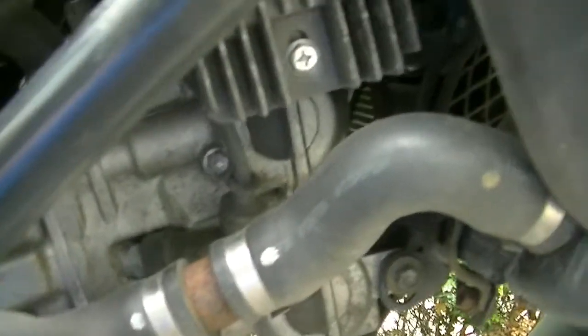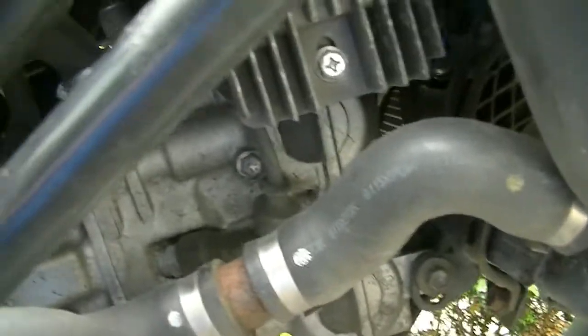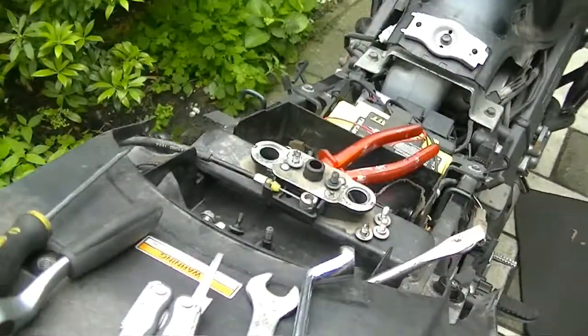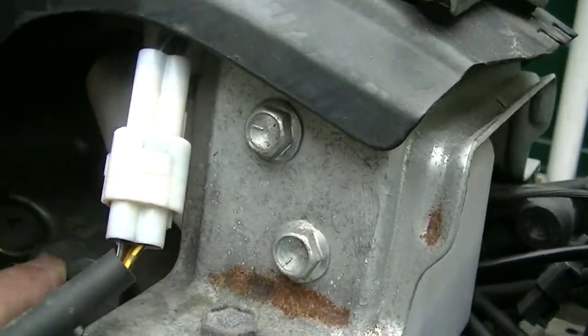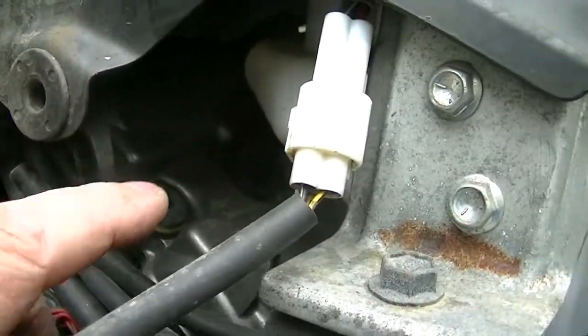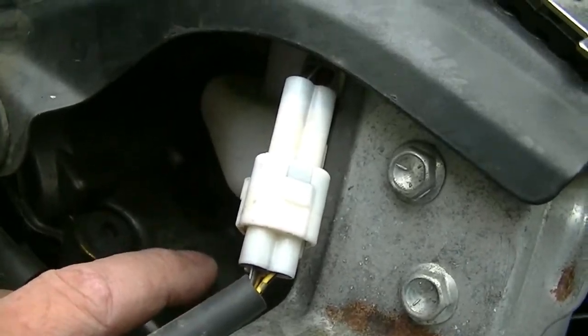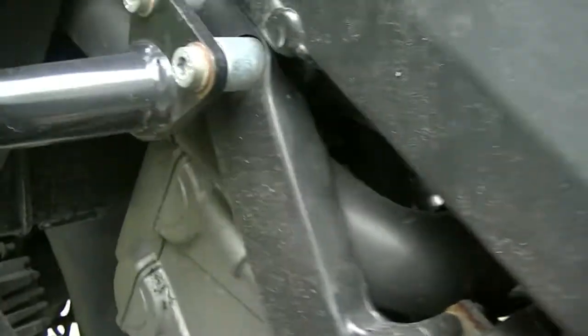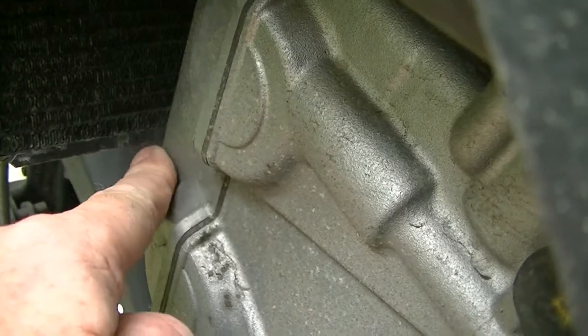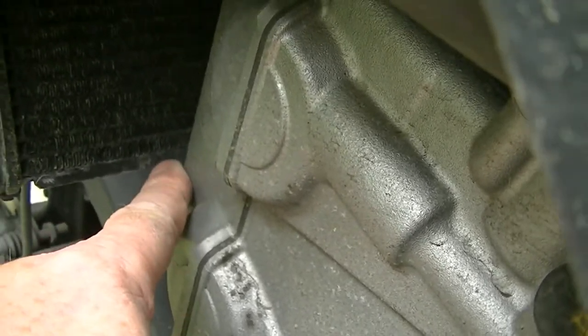And if I'm in there as deep as I'm describing now, I'm just a fool not to lift off the rocker covers and check the valve clearance as well. And the same, of course, with number 2 cylinder, where I do have access to both spark plugs with the tank just lifted up, but where I still need to remove the tank to lift the rocker cover off. Here you see it even more plain. This is rocker cover cylinder number 1, and that is the radiator. There's less than 1 centimeter between those.